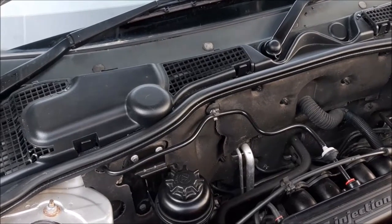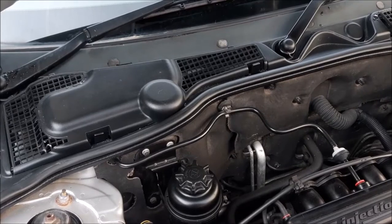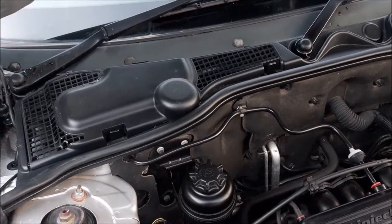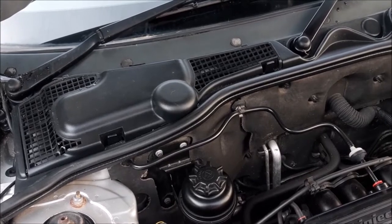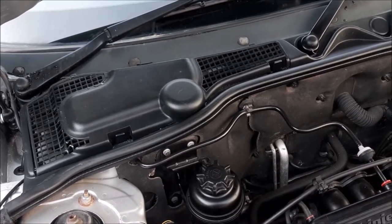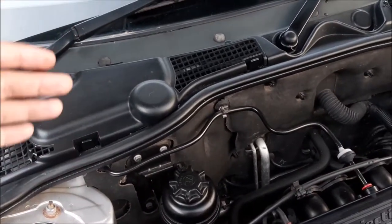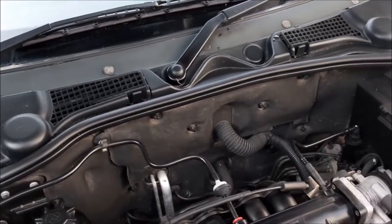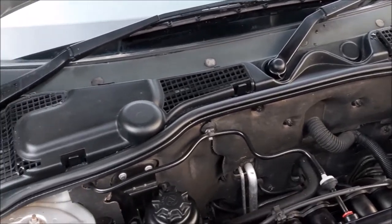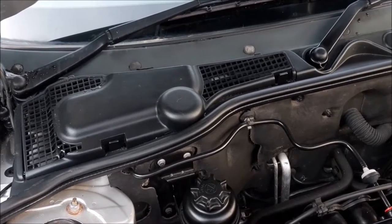So we're on our Rover 75 here at the DPN car collection, and I've had this little video, kind of a maintenance thing we do, but something that's also good if you just purchased a Rover 75 is to check that this void here, in between the bulkhead of the car and the bulkhead of the engine, I think some people call the plenum chamber, is cleared out and that it isn't filling up with water due to the little drain blocking.